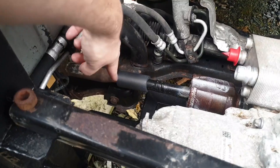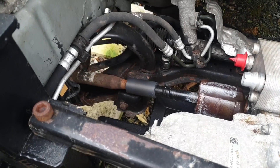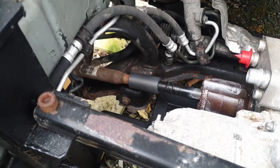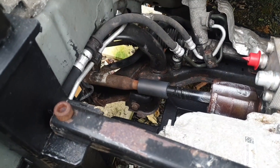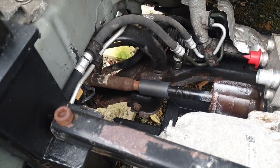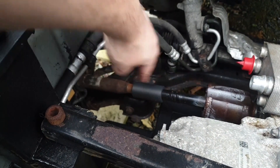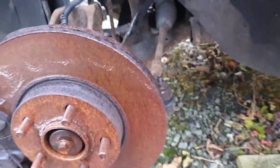It is joined up with a 3D printed carbon fiber polycarbonate coupler. That's obviously not going to be the finished article, but I'm using it here just as a way to get my drive shaft dimensions correct and check that everything turns freely and so on. Then we'll be getting that one, and indeed one for the passenger side, made from steel and sweated on, so that we have the Tesla end here and the Volvo end here.